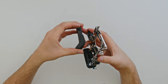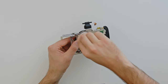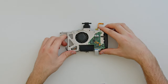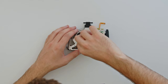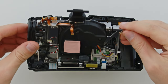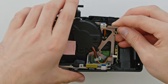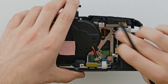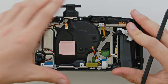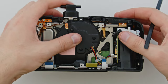If you're modding a Pocket 4K, you need to reinstall the fan now. Slide the heatsink fins through the hole first, and the rubber gasket around the fan should slot into the shaping of the steel frame. Use the same five Phillips bolts from your fourth container with the small Phillips screwdriver. We'll now place the steel frame back into the camera enclosure. Tuck the frame underneath the ribbon cables at the bottom of the camera, and then carefully pull each ribbon cable through its respective gap. We need to ensure the black power cable isn't trapped behind this frame too — use the sharp end of the plastic spudger to gently pull this cable through. When all ribbon cables are showing through correctly, push the steel frame back into place.